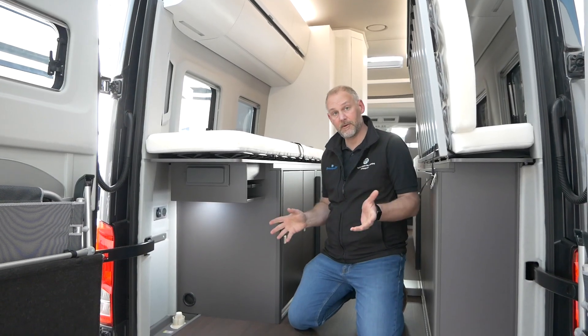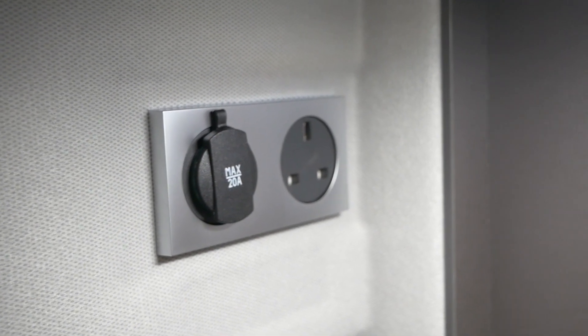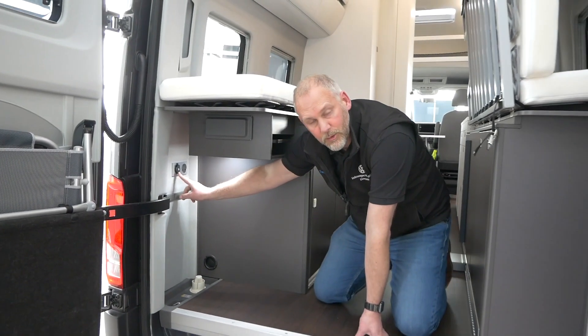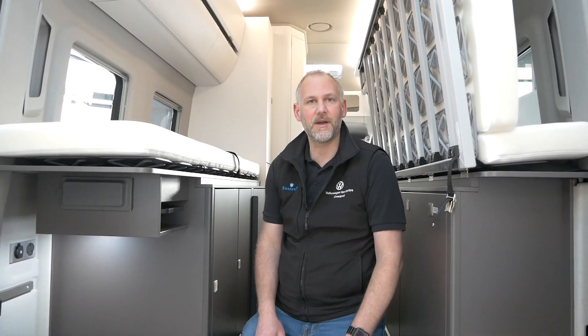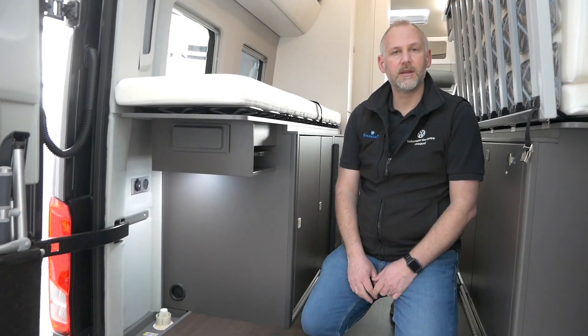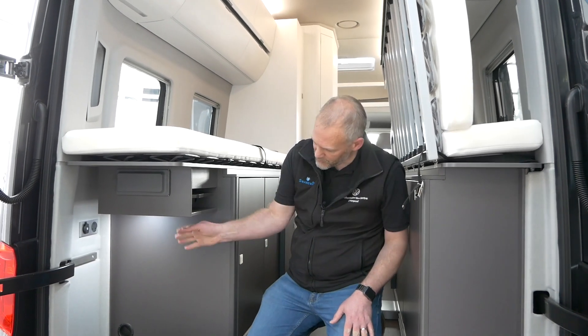The final ones are in the back of the vehicle. This vehicle doesn't have the air-conditioning system, but that is the one system that only runs off mains power supply — you have to have electrical hookup for the air conditioning to work. In the rear we've got a main UK plug socket for when you're plugged in, and next to it a 12 volt socket with a higher 20 amp rating. That's handy for things like a portable fridge, which you can plug in here and take in and out quickly.